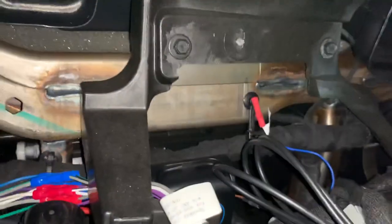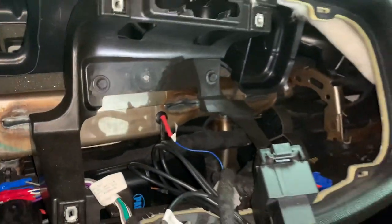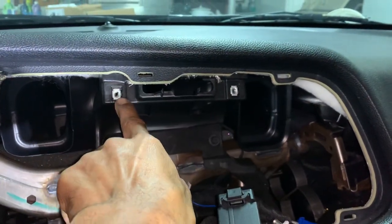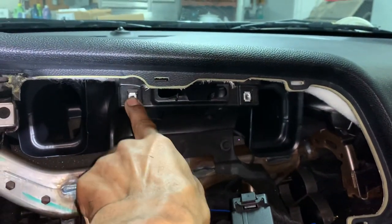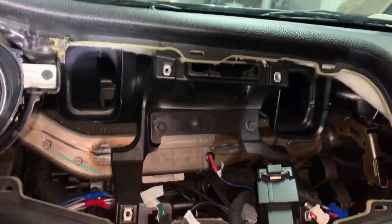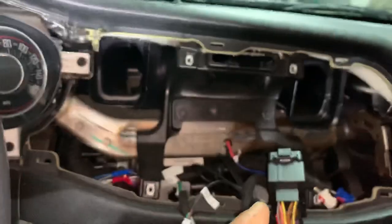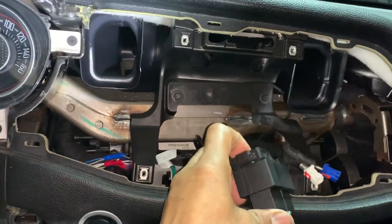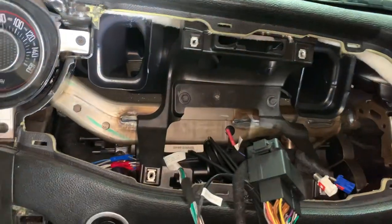Once I straighten out all my wires I'll probably shoot a screw in here and bolt it, or maybe zip tie it to that harness back there. Pop this bezel out — four screws, seven millimeters, and there's also a Phillips head inside that seven millimeter, so either works. Remove the unit, unplug everything, and be diligent — you don't want to break this plug.